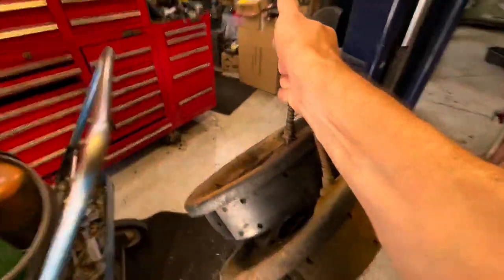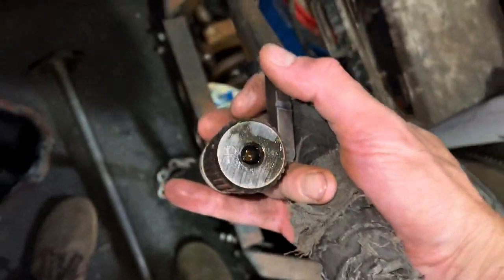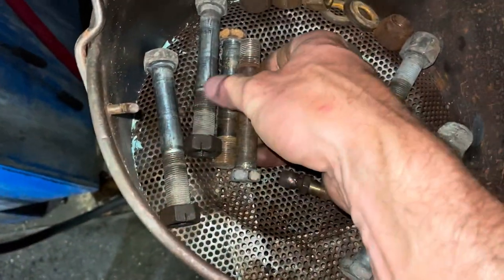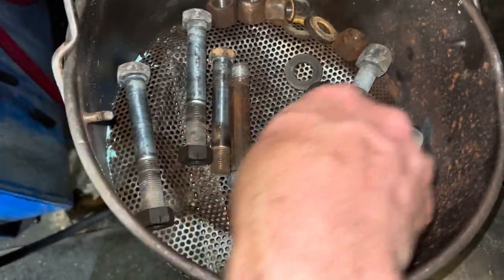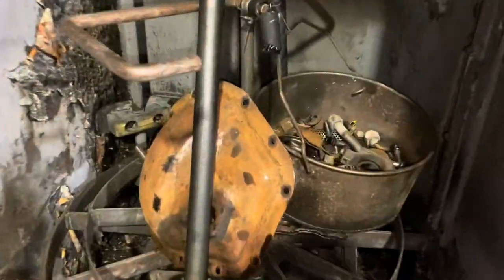We just got here to Roger's to get this stuff in the dip tank for a hot wash and cleaned up. And I have to say — it's seriously awesome having Roger to learn from and be able to just drive over here and do all this stuff. We're very blessed to have him. I'm going to punch and label all my parts by their respective sides so this one from the passenger side gets marked. Stay organized, don't lose your parts. We've got the hardware, U-bolt hardware, leaf spring hardware, and hanger hardware sorted.